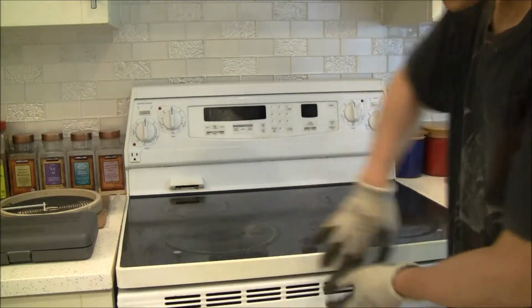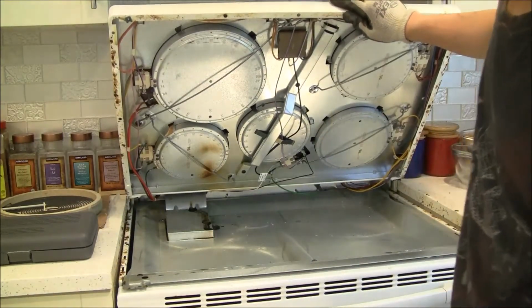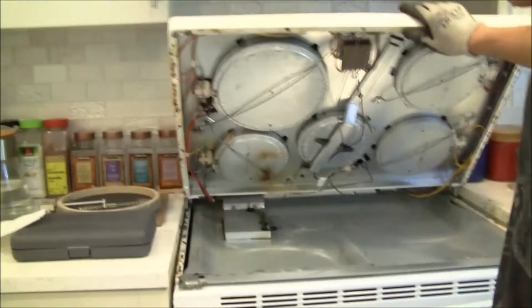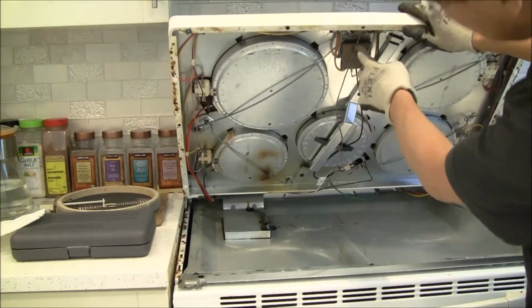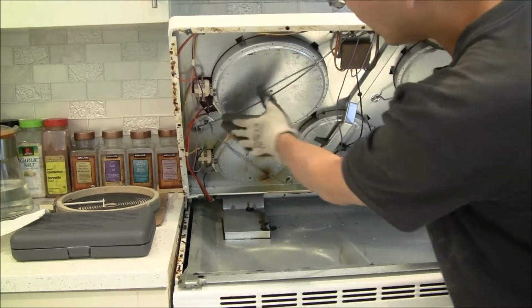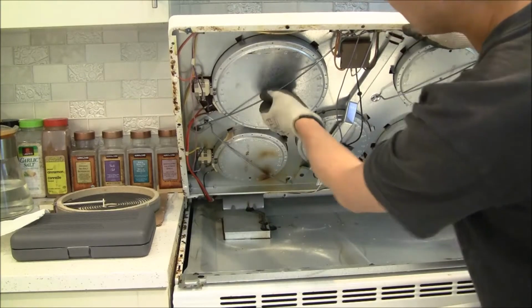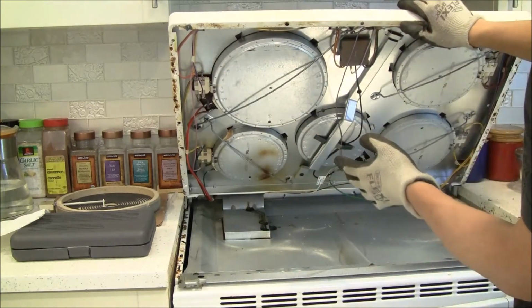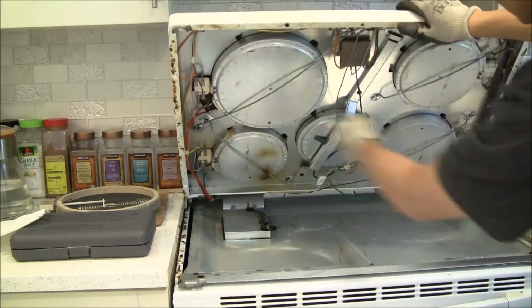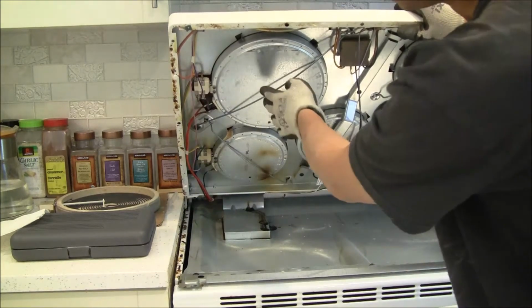Once the screws are taken off, you just lift, and voila. See the inside. Basically, here is the dual heating element. It's put in place with a metal stick screwed in place. So we're gonna unscrew this so we can take this off, and this whole thing hopefully will come off. If you have a different model like Kenmore or something, it may be different. I've seen it with a metal bar across to hold everything in place. Anyways, it should be similar, and easy to take off.